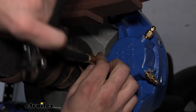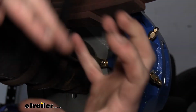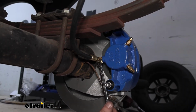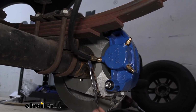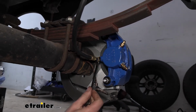And this is made of a softer metal, because we want these metal pieces to kind of form and seal to one another. So this 3/8 wrench here, if you were to just use this wrench, what most likely will happen is we will strip out our line here, and then you're going to have a difficult time tightening it down and getting it loose again to repair it. Very easy to damage your lines with this because of the tightening.